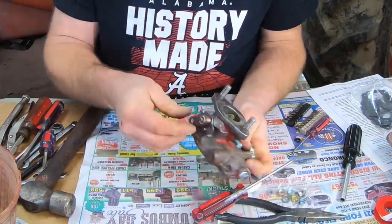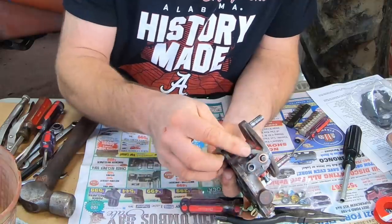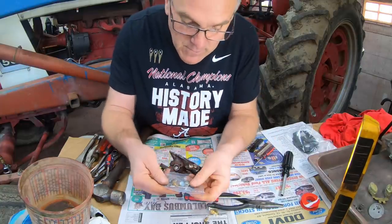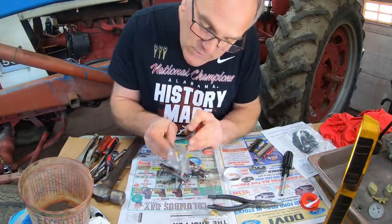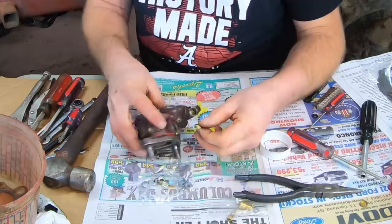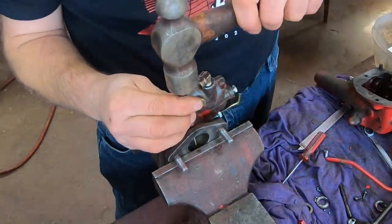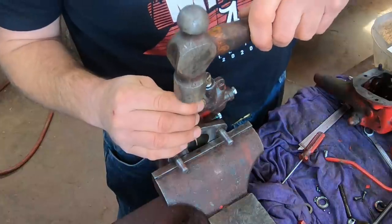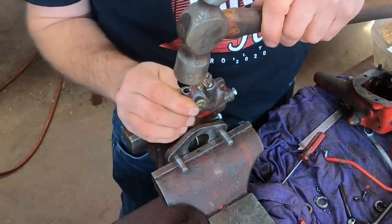That works the way it should — back and forth. This is one of the throttle limit screws. I've got to put the plug in the other side, and I've got to find the right plug out of this pack of miscellaneous parts, some of which fit this carburetor and some of which do not. Just tap this in here — it's got to deform a little bit to be tight in the bore, so I use a socket that's a little bit smaller than the plug.